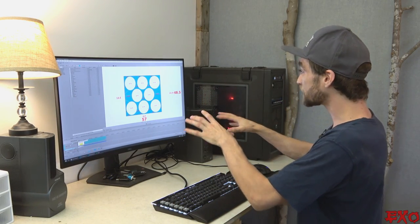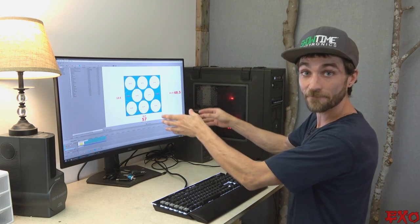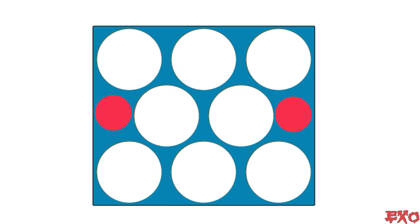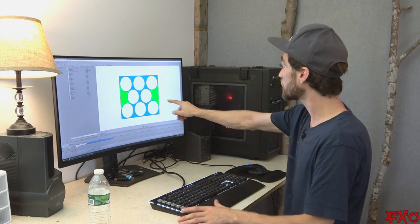A good way to maximize port area in this case is using the baffle itself as part of the port. So instead of sticking an aero port or a regular slot port in there, which would drastically limit size, I'm gonna open up the port as much as possible, all the way to the outer shell. That's a single common wall in terms of port layout, but an opening that spans the complete distance now.